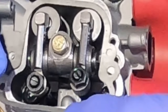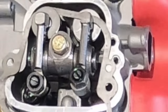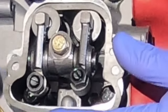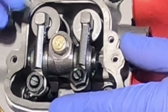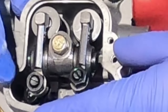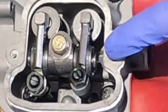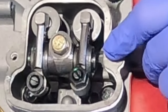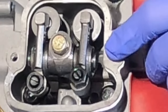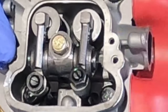See right there where the split of the gasket is? This will also glue a gasket in place pretty well, but I don't want it all over it — just one little speck right there where this gasket has that tear. I really love this particular sealer because if you try using silicone sealers, they can have a tendency where you have a little bit of overrun on the inside. They'll make little balls of silicone that as they get old will drop off into your cylinder and can stop up things — especially inside motorcycle engine cases. I've seen people put it together with silicone and it winds up completely stopping up an oil passage and burning up an engine. If they'd have just used the correct case sealer, they would have never had an issue.